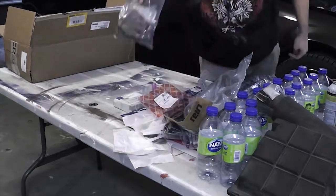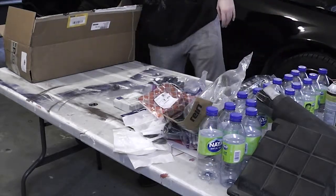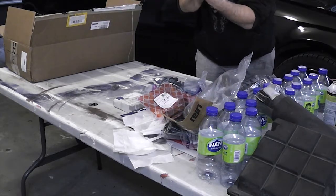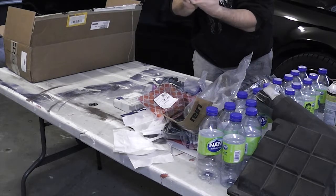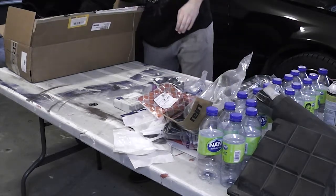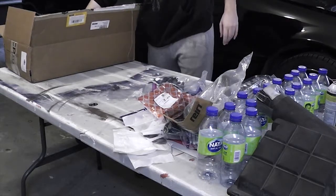I also have a new set of cylinder head bolts. They are torque to yield and thus must be replaced when the cylinder head is removed. This set actually comes with enough bolts for an M104, so you will have 4 extra bolts. It was cheaper than buying them individually. Next are Bosch F8 DC4 spark plugs, non-resistor, copper core, and the best you can have for this engine.